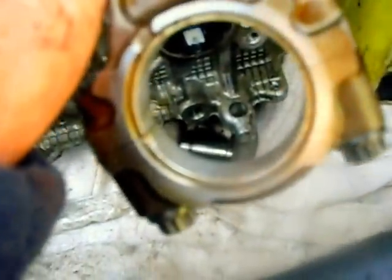Here's a normal car engine. One, two, three — the extra crank bearings you have on the Prius are absent. Normally it's only racing engines that have the five bearing crank. The advantage is that the crank itself doesn't flex, so the bearings sit square on the journals. Despite the fact that this engine has done 100,000 miles, the bearings are absolutely sound.